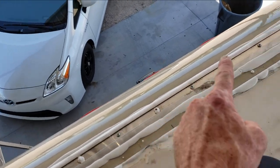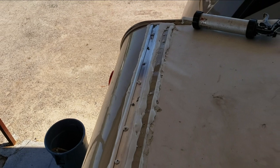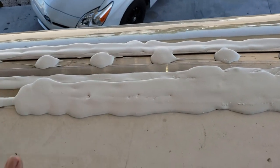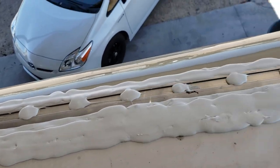What I had to do was fill up all of this right here with Dicor so it'll all be encapsulated. The factory should have secured it like this originally — this overlap shouldn't have existed, it should have been trimmed off and that just would have been the rubber roof seam right there. But because there are so many holes, I can't leave it like that. I put a bead on both seams, covered each screw hole, sealed underneath — unlike the factory — and brought this entire edge all the way across.